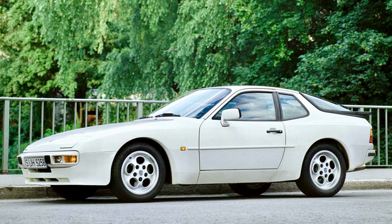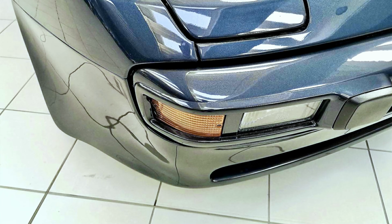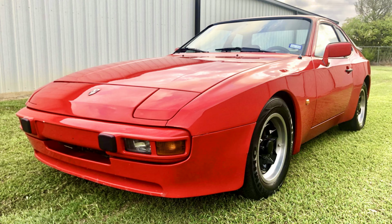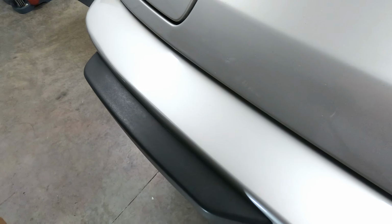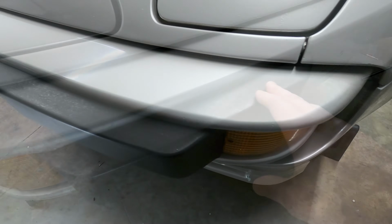Because the rest of the world had different traffic safety standards at the time, you'll often see sleeker-looking fiberglass bumper caps on most of the Euro cars, as came standard, all while offering little in the way of impact protection, but aluminum bumpers with impact absorbers were available as an additional option via code M058.